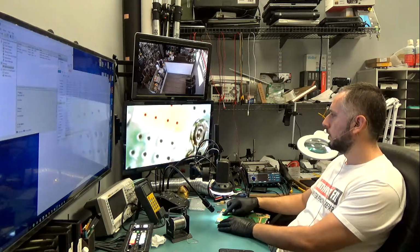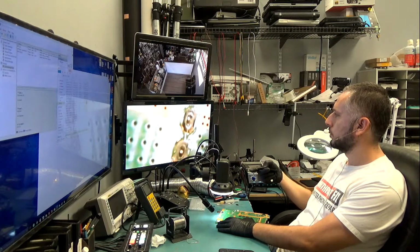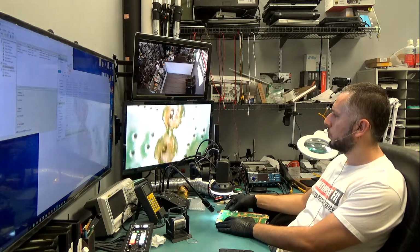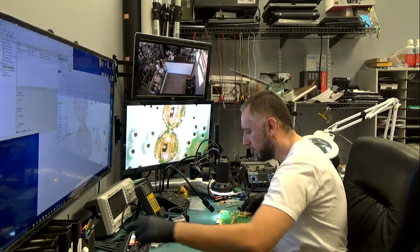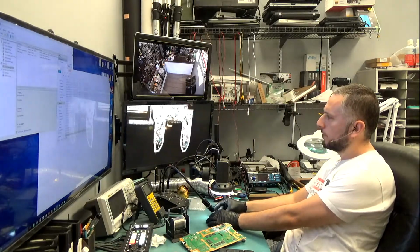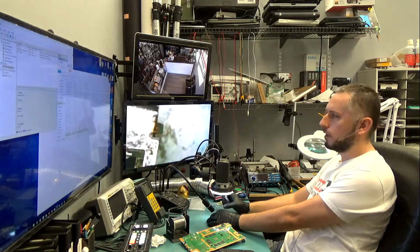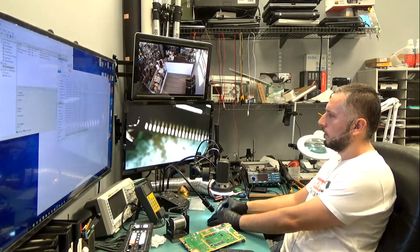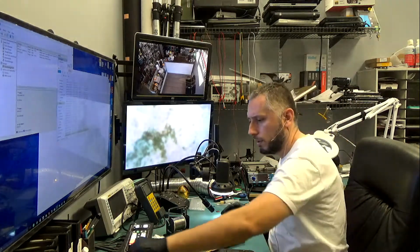So we have two over here. One, two, and we have two over here. The way the connector looks like is this. We have two hooks on each side. This will get soldered onto the board so the connector is solid and stable on the board. And we have the front pins that we must solder. Okay, so after this is done, we should have a working HDMI port.